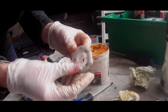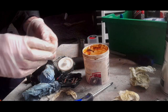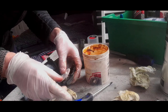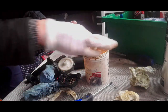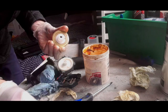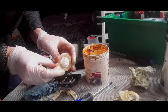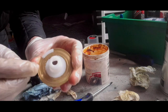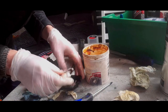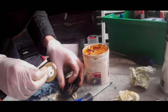We can pop this contact plate, which, yeah, that's actually been cleaned up really nicely. And we are just going to pop it down now. What I will do is just smear grease around the shaft again. Lovely. Okay, they should make very nice contact. I think the intermittent is the outer one and the inners are the newer ones, but that's fine. They shouldn't wear out based on what I've just done.